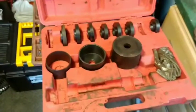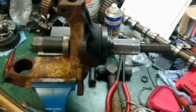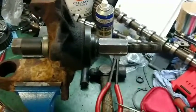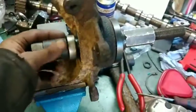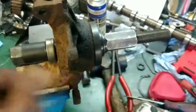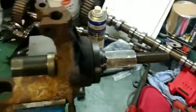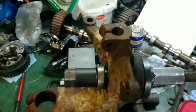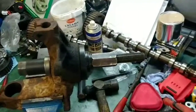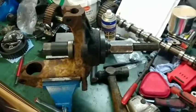If you have a wheel bearing tool such as this, you'll be able to take it off on the car, but I took it off the car anyway. I don't have a press, so I'm using this instead — it's just a finely threaded but quite chunky bolt. I'm going to hold it with a spanner on one end and turn it with a big ratchet on the other end, and it should knock it through. Sometimes you have to help it by hitting the end gently, otherwise you end up mushrooming the end and that's no good anymore, but it will go. We'll get this wheel bearing changed out — once you've got it out, the new one goes in a lot easier. It's getting it out that's awkward.